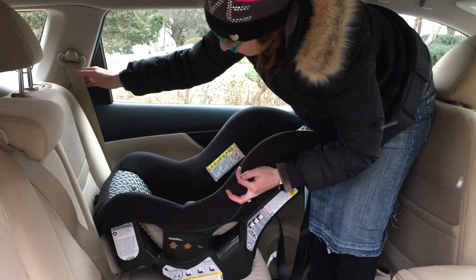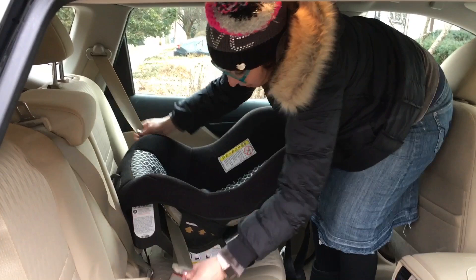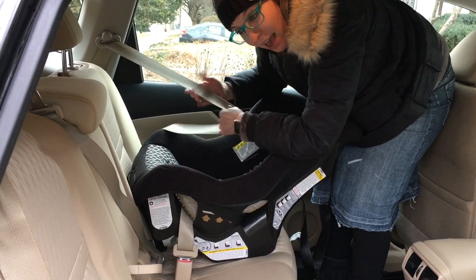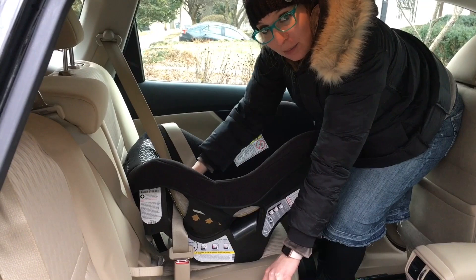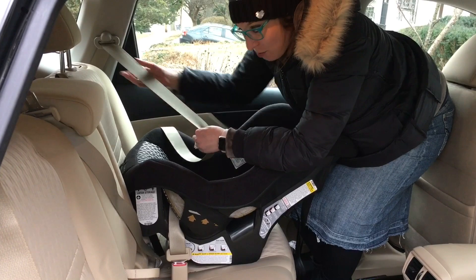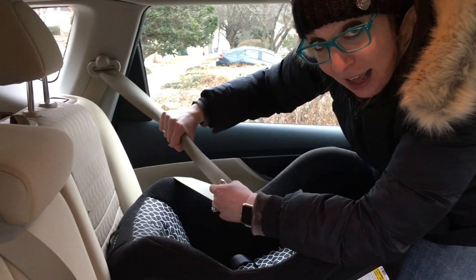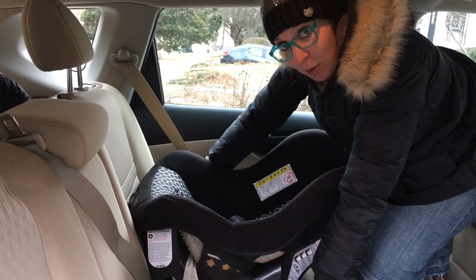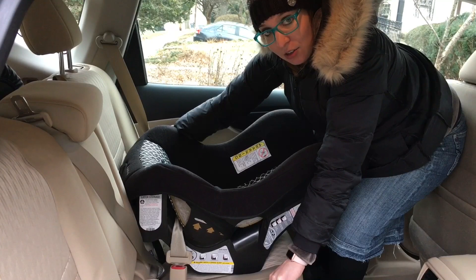The first thing you're going to do is pull out the seat belt, thread it through the belt path, and buckle the seat belt. Every vehicle made from the manufacturer's year 1997 and newer is required to have locking seat belts. In this vehicle we have what's called a switchable retractor. To switch this into locked mode, pull out the seat belt all the way until it stops and let it go back in. You'll hear a ratcheting sound, and when you try to pull the belt back out it's not going to come back out. Not all vehicles have switchable retractors — sometimes the latch plate, which is the part that buckles into the buckle, will have a switch that needs to be switched to lock the seat belt. If you're not sure how your seat belt locks, you can consult your vehicle owner's manual or meet with a CPST.